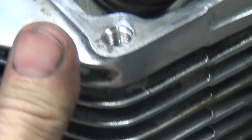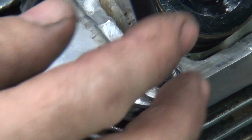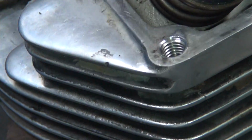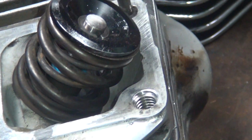So you have to see where your hole's at. The tang is right there. So it's barely down below the surface. Okay, make sure you don't go out the bottom. If you go out the bottom, the helicoil won't stay in. So I'll go that much further. So now it's over here. Pretty much a full thread down. So when you put pressure on it, you won't hit against the helicoil. There it goes. There's your turd.